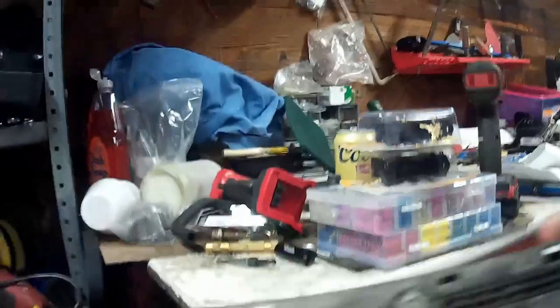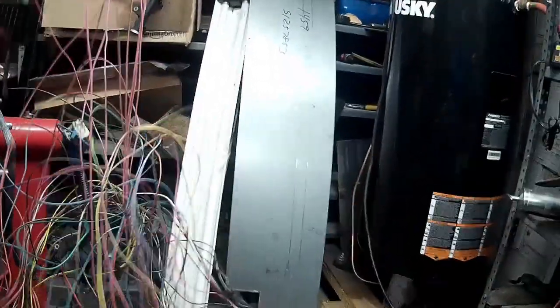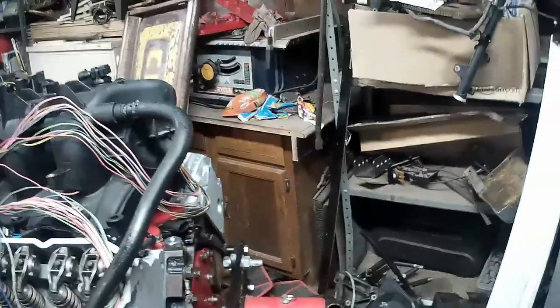All right, I'm back. I depinned the plugs completely. I put their color coding back on them, so I've already marked them anyway, but I'm going to go ahead and clean off the backsides. I'm going to clean up this wiring here. It looks like most of my wiring just cleaned itself up when I did this. All my injectors and everything are right there on that leg. So this is already working out for me pretty good.